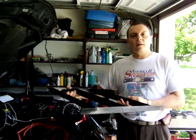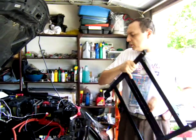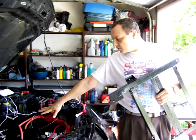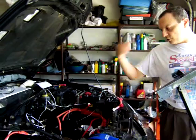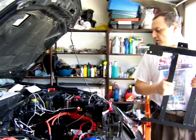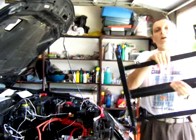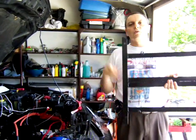As I told you before, the racks for the batteries are ready. I made them removable because they sit on top of the motor and the transmission, and if I ever need to remove or work on the motor and transmission, I don't want to be breaking things to get them out. So I made these removable — they are fixed with screws.